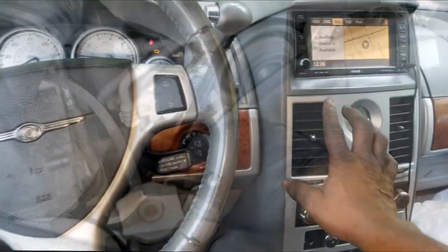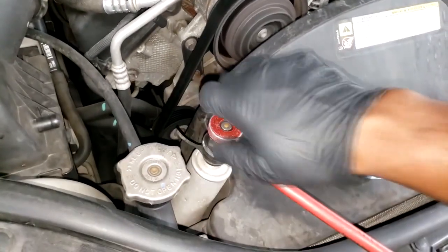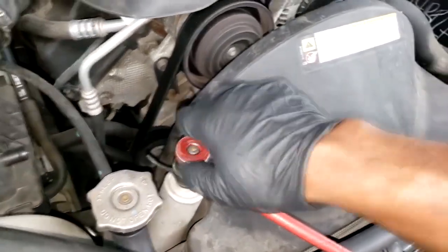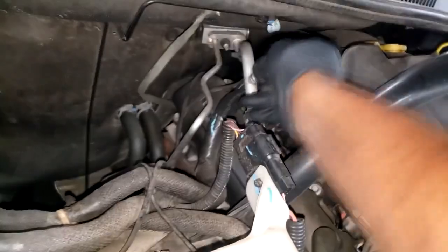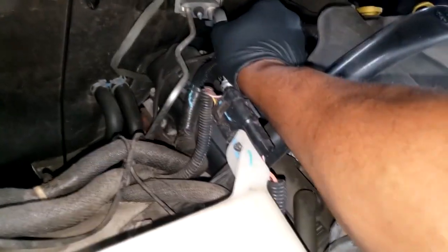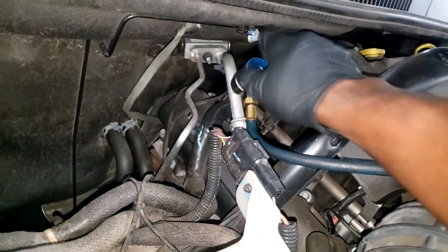All right. Yeah, it's not cold at all. With an AC system service, guys, I'm entitled to 1 pound of refrigerant and some AC dye. So what I would do is inject both of those, the dye as well as the pound of Freon. That would get my AC back cold because technically it's not all the way low, it's just maybe a pound short. So now from there, I advise the customer to drive it until it all leaks out again.